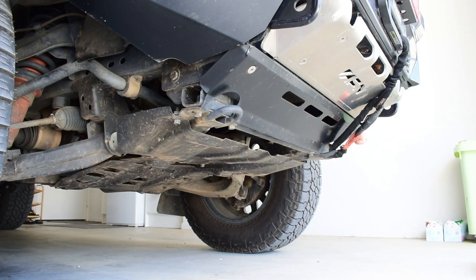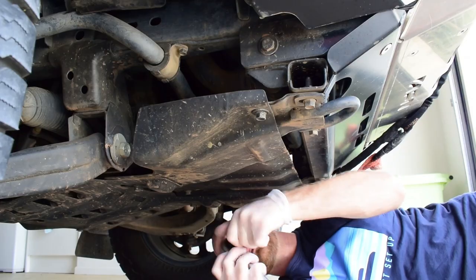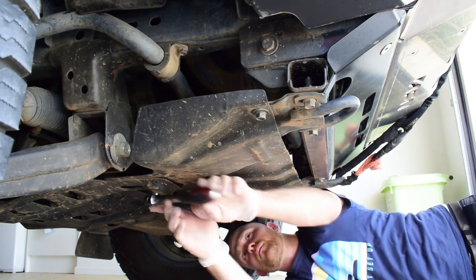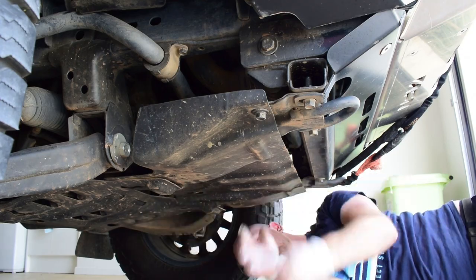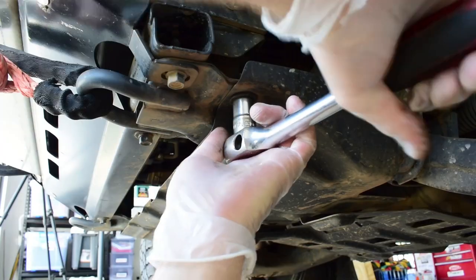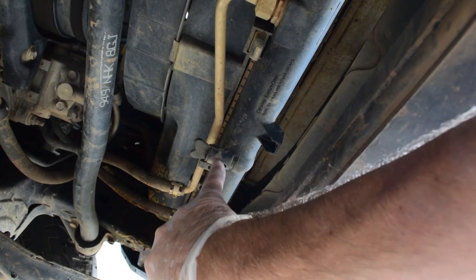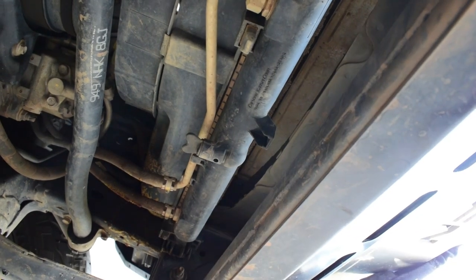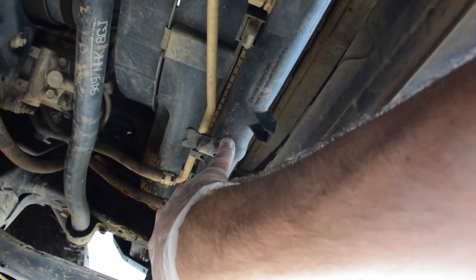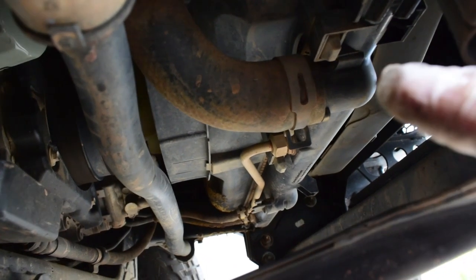I'll just chuck my bit of cardboard under, and now we can take off this undertray to gain access to the drain. What we've got here is our radiator drain — you can see the little bung here and the drain hole. We're just going to get our tray under here and loosen off this bung to allow all of that coolant to drip out of the radiator. Most modern vehicles do have a drain bung like this, or a little plastic bung in the bottom of the radiator which you remove. If you have an older vehicle without a drain bung, you can just remove the bottom hose.